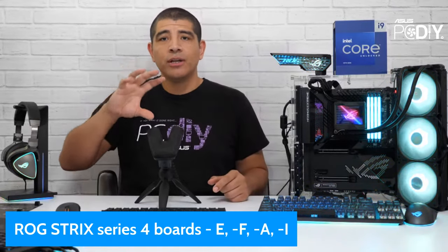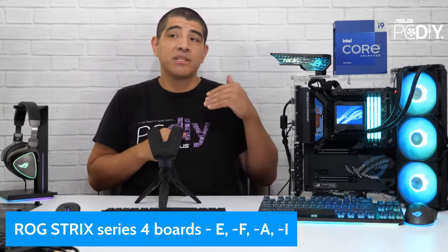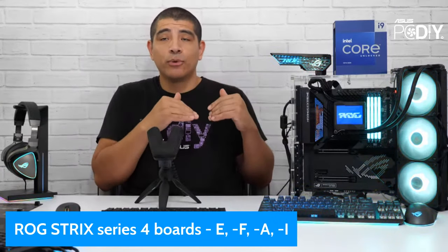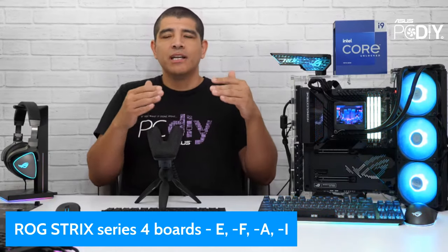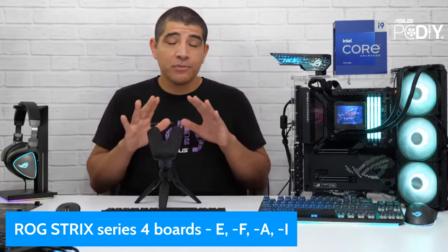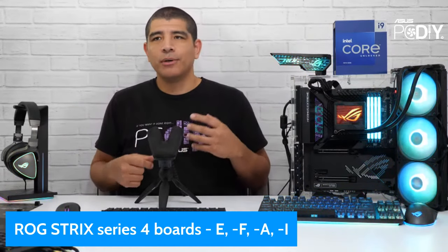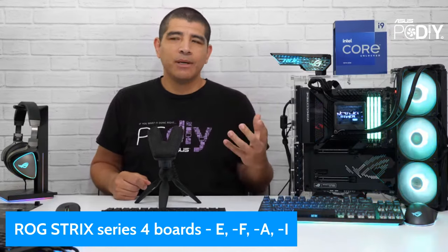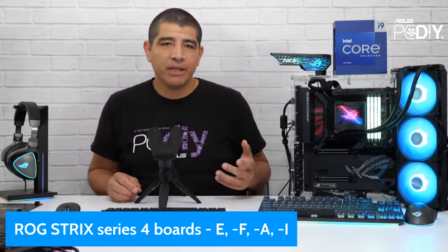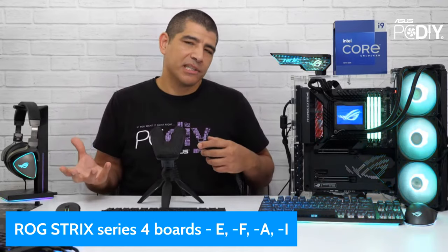because depending on the load, the current that you define, you can then target that the overclocking comes into play under those light workloads where the cache would be overclocked, but then it would go back down when you're talking about a more multi-threaded workload. So again, if you were maybe going from using something like Photoshop or gaming, but then all of a sudden you started doing Premiere, where one's going to be more lightly threaded and then one's going to be more multi-threaded.